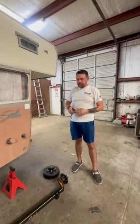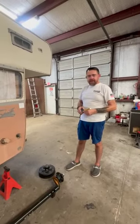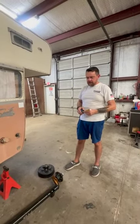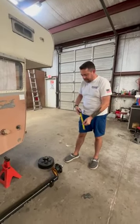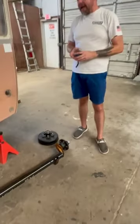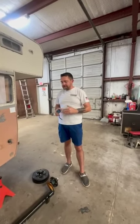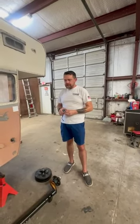So we're going to start off with the bolt pattern. We went over that. Then we went over hub face to hub face. And then we went over spring center to spring center. And then went over idler, which means no brakes, or brakes. Those are all questions they're going to ask you. Going up and down and all around, it doesn't get real confusing if you just stick to the basics.